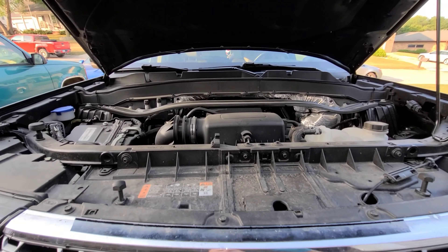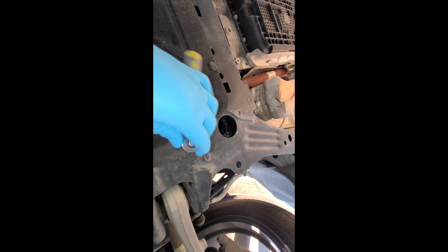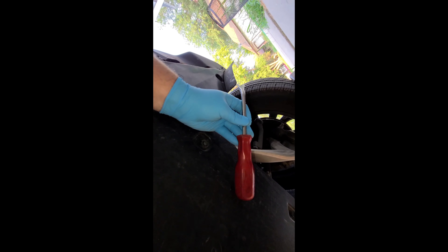I'm going to go ahead and get things ready. Here's the front bumper — you have this plastic skid plate and then that little fiber one. We're going to want to remove that. You've got some 7 mil bolts and then it looks like a couple Christmas tree clips. I highly suggest investing in one of these clip removal tools — the more cars you work on, the more happy you'll be that you have them.